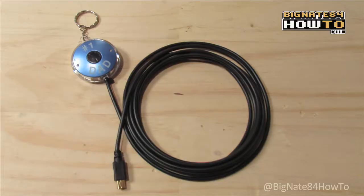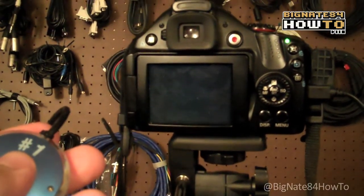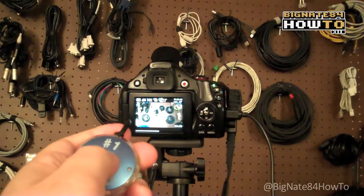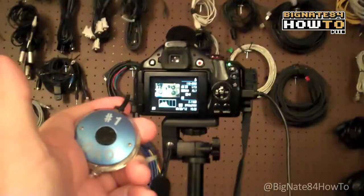It may take a little practice to get the hang of it. The button needs to be pressed down and held down. While the button is still being held down you'll hear a beep and see a camera icon appear in the bottom corner of the display or viewfinder. Once you see the icon or hear the beep, release the button and press it quickly again. The picture will be taken at the time of the second button press. Pressing and holding the button is equivalent to a half shutter press for autofocus. Letting go and pressing a second time is equivalent to a full shutter press.